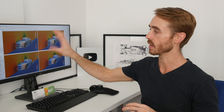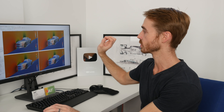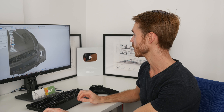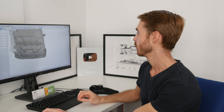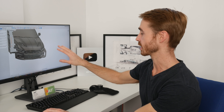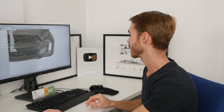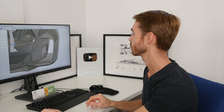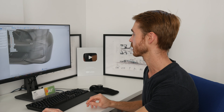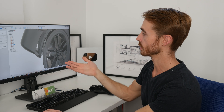I've done four runs. I've got a baseline run of just the stock car — a 2015 Ford Mustang — and then I've added a ridiculous external air curtain to it. This huge air curtain on the outside is basically an in-washing airfoil profile that blends into the bumper — that's my biggest step of an air curtain. The other two runs involve cutting out the fog light and smoothing the area: one run just with the area smoothed and the air curtain blocked off, and the other with an actual air curtain ducted all the way through with a rear exit, much like we saw on the Kia Picanto.